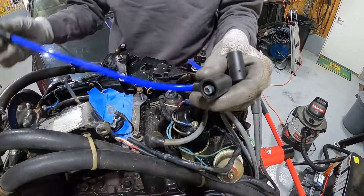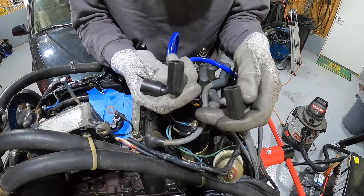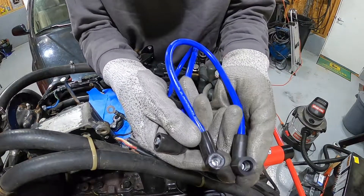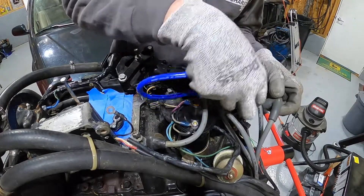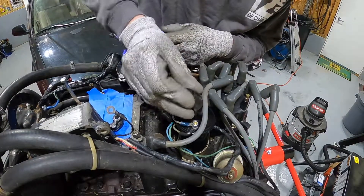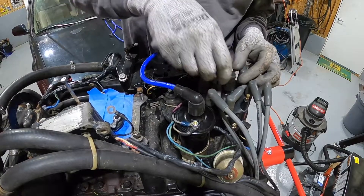This one right here is the coil wire — it's got the piece that goes down into the coil. All the rest are going to have open-ended pieces, and you figure out which ones go on your distributor cap versus your spark plug based on their size. The distributor cap end is a little smaller, the spark plug end a little bigger. These are going to look slick — not much, but it's honest work. Get rid of the old stuff, get the new stuff on there.